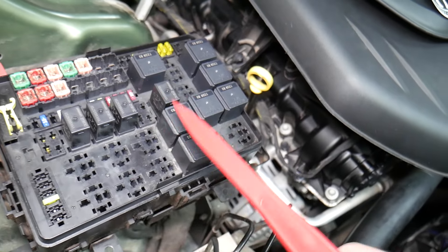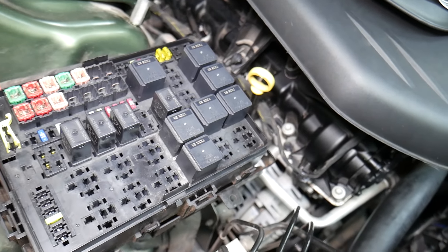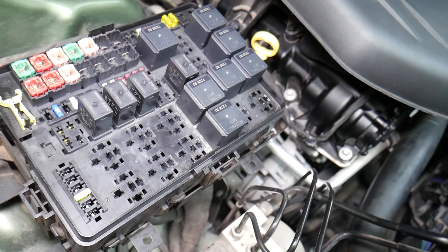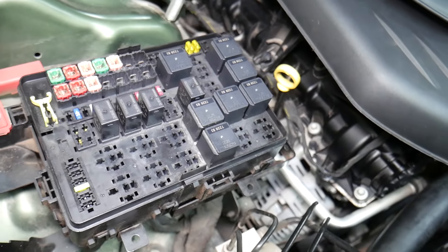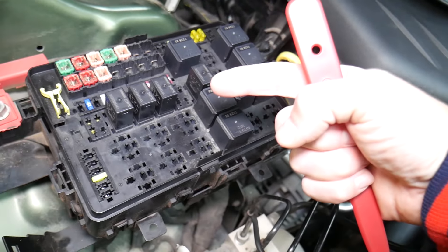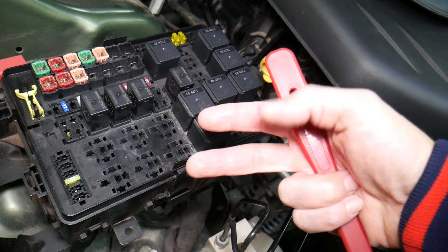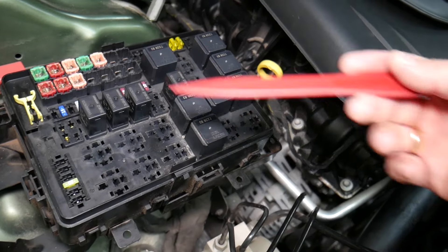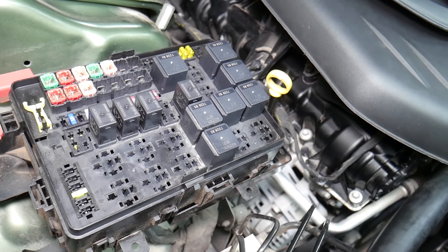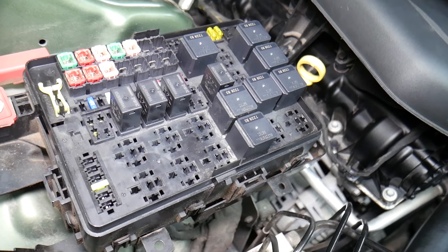For certain fuses, it's important to disconnect the car battery when removing them, otherwise you can burn the electronics. For instance, when working on airbag fuses, you need to wait at least one hour after disconnecting the car battery, and if you're not qualified and certified to work on airbag systems, I would never recommend doing that. Also, it's important to know which battery terminal to disconnect and reconnect first — if you do it the wrong way, you can burn electronics modules. We actually burned a traction control module on a BMW that cost $2,000. We'll put a link in the description on which battery terminal to disconnect first.